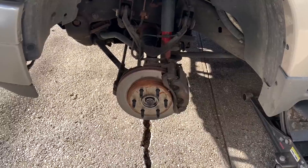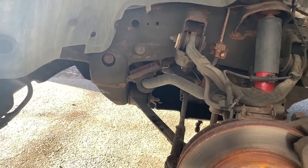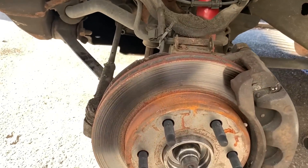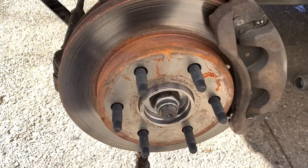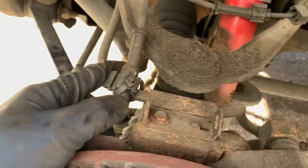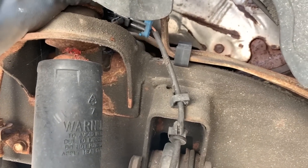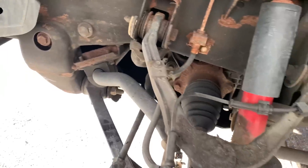I get the front end to shake and everything's tight — ball joints are good. There's the usual little kind of side-to-side steering box slop; I'm probably just going to go in there and adjust the little nut on the top to try to tighten up the slack a little bit. As far as the front brakes — same thing as the rear, they look brand new. Nice new rotors on there, new pads, just a little rusty from sitting in the yard. And look at that — just like I suspected, we even have brand new hub bearings on the front. So that's not something I'm going to have to address. The only thing I'm going to come here and do is — for some reason whoever changed the bearings just zip-tied this to the hose. It's supposed to clip into that bracket and this is kind of ran all wrong.